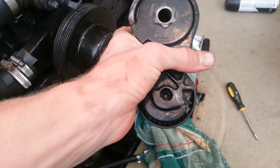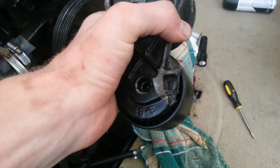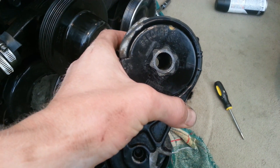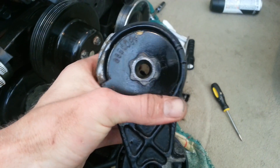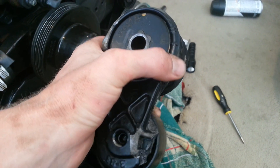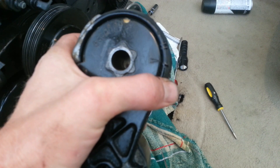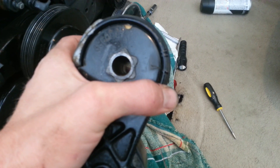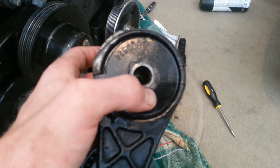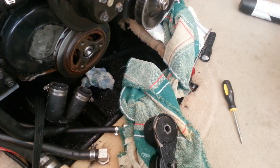What I was doing was I was changing out the belt tensioner. I wanted to change the belt tensioner because that piece where you stick your 3/8 ratchet in to get your belt tension tight was broken off. The paint was all coming off. I got one on eBay for like 70 bucks. That's where it was when it was on the engine with the belt. It never lined up fully, so this belt was gone, even though I thought it was a new belt.